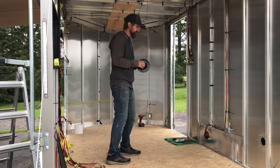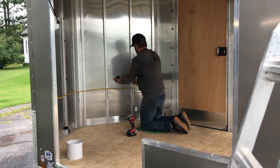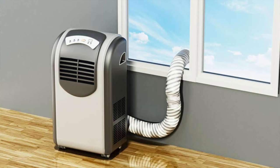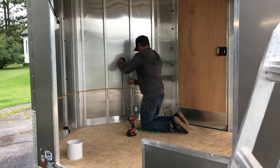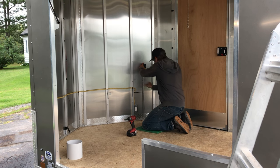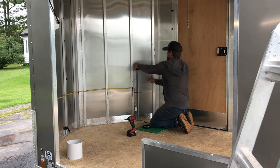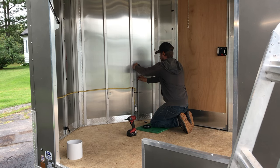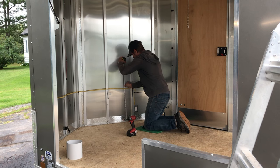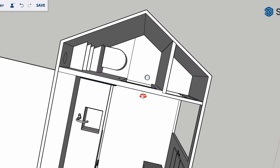You can find them on eBay or Amazon. Figuring out where to place the ports - most of the time with these air conditioners the hose comes from the bottom, goes up, and goes out. I could have gone straight out the back but I wanted to keep it above the rock guard up front, so I'm basically replicating how it would be installed in a house. I considered going out the side of the trailer, but I'm trying to keep the closet about two feet wide and make the proposed bathroom to the left of it as big as possible, so out the front we go.